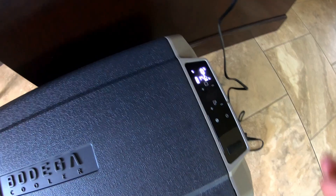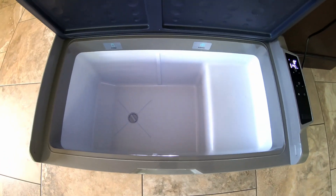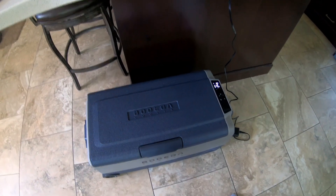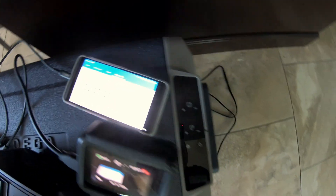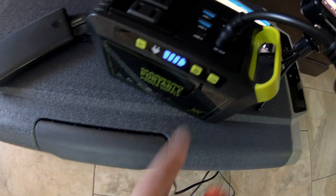12-volt compressor fridge test. This is going to be a worst-case scenario. I've got the cooler set to zero degrees Fahrenheit, on eco mode with low battery protection mode on, so it will run as long as possible. It's empty, so not much thermal mass. Your runtimes with stuff inside will probably be greater, but it's helpful to have a worst-case benchmark. This power station just got charged up, so we are full. It's registering three degrees but set for zero, and ambient air temperature is 72.7.